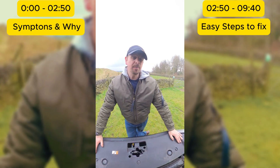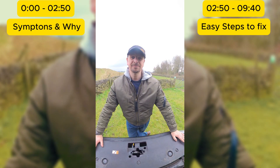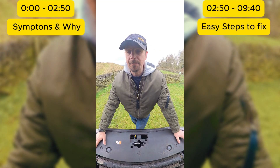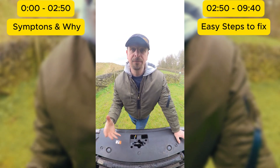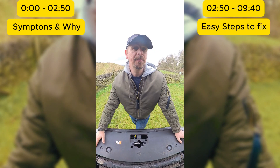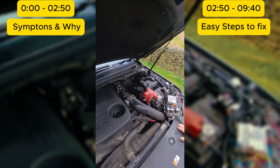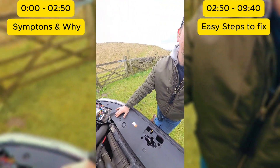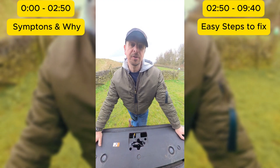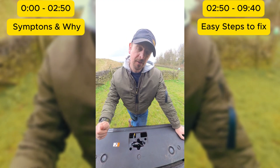Welcome back to the channel. Today I'm going to show you how to simply bleed air from the high-pressure fuel line on the Ford Ranger or the Mazda BT50. Some symptoms of having air trapped in the fuel lines include difficulty starting the car, the car cranking but not firing, cranking then cutting out, rough idling, or misfiring. In a diesel, this is significant because it disrupts the pressure and preciseness within the injectors.